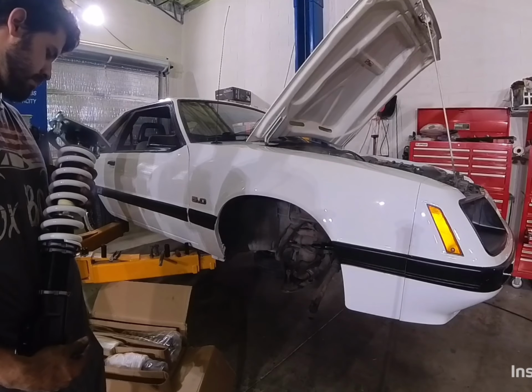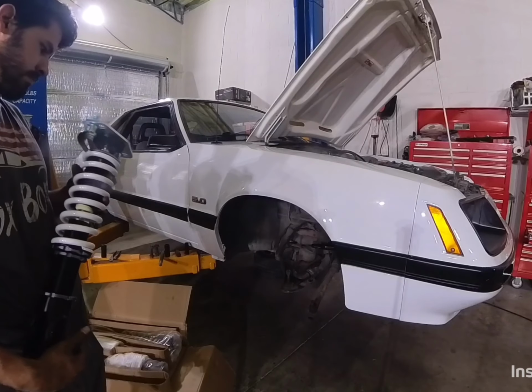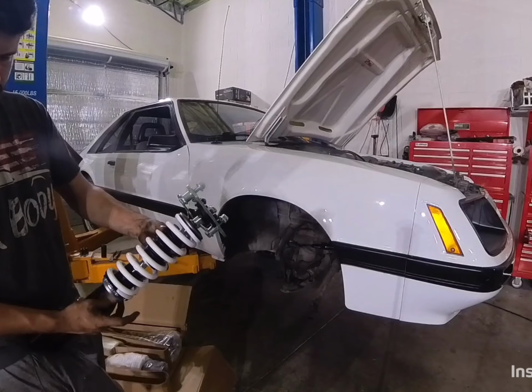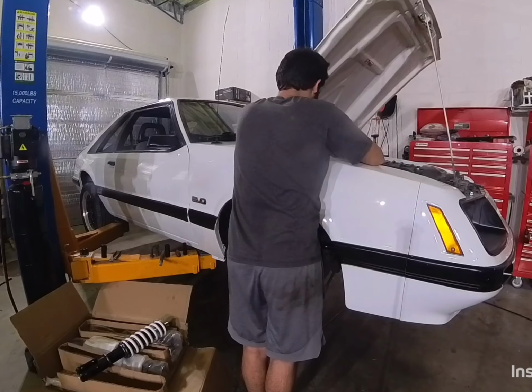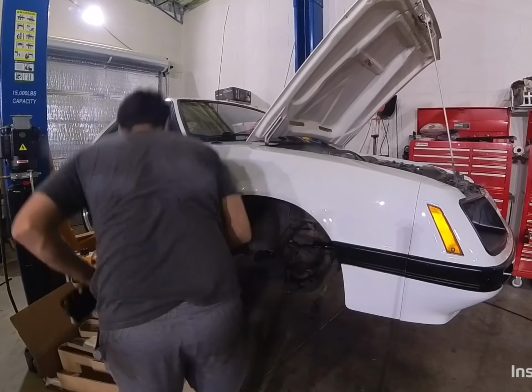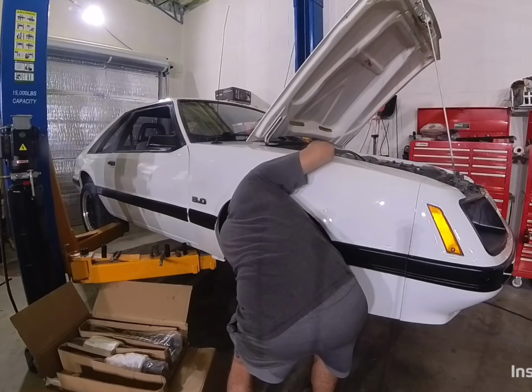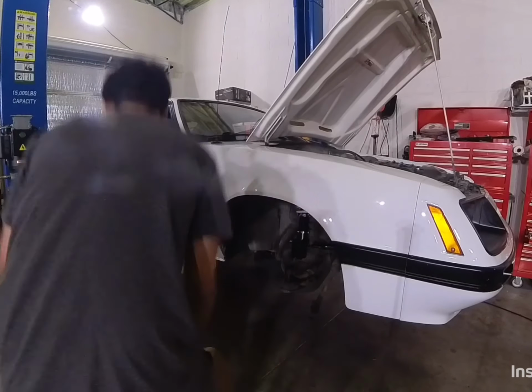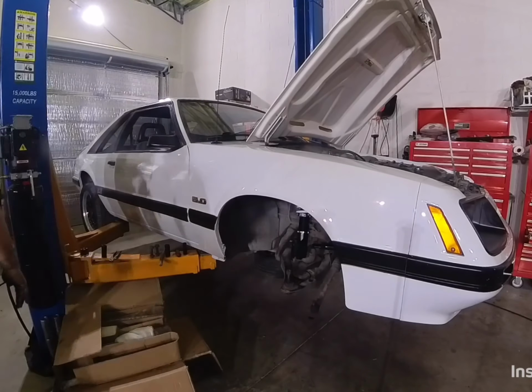Okay, so on the front coilovers, there's a top nut for the shock. You can take that off and it'll release it from the caster camber plate. And then there's three more nuts on top. You take them off as well. And the little J part, you can stick up under it without the shock in place. And then put those three nuts back on top.